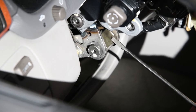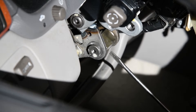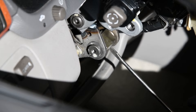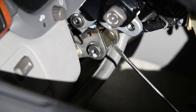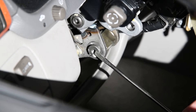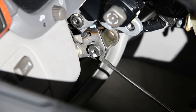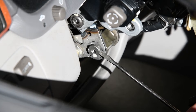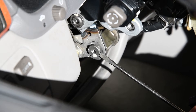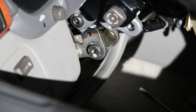Here is the tilt nut that needs to be replaced — this is where the motor goes in, and it's been stripping the gears when it came partially out. To remove this piece, I have to take out this holder right here. The way you do it, you have to pull it straight out — it doesn't screw in, it pulls straight out. They make special tools for this but I couldn't find one that fit the Lexus very well, so I had to make my own.